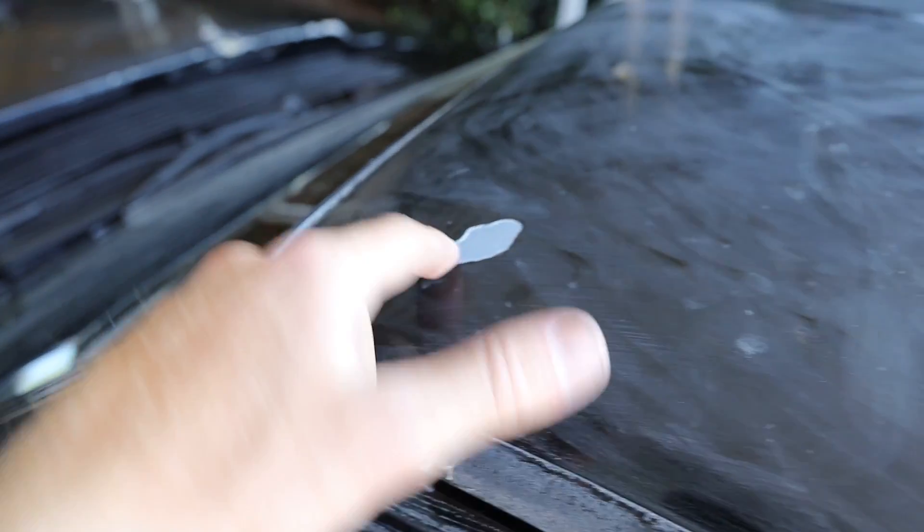You can see the lines up here on the roof too. At one point this thing was sanded but not to a high enough grit and blocked out before it was painted on the roof, which is probably why there's things chipping. But now I can run my hand across and it's really smooth. I have a feeling when we buff this it'll come up better. I'm going to make the trunk to the glass, the roof, the hood, all seamless.